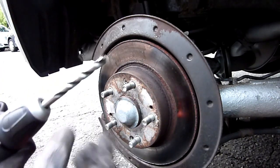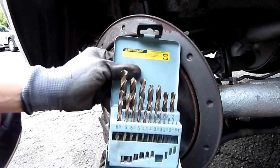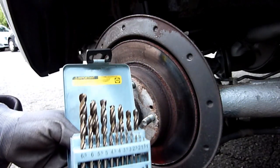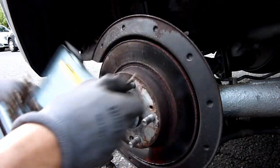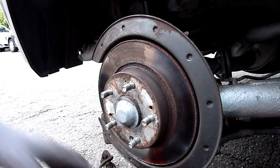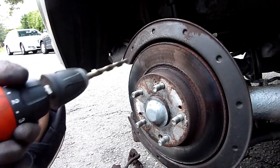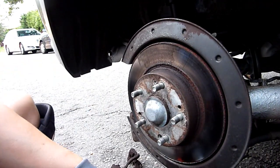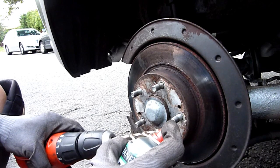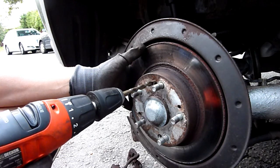I don't mind — this is an old drill bit, I don't mind running it off, which I have done. Now I'll use my decent drill bit — these are cobalt, about £23 from Machine Mart. I'm picking a smaller size now, just to get rid of that cross plane. Add some cutting oil. Give yourself plenty of time to do this — it's not a quick job. The slower you take it the better.